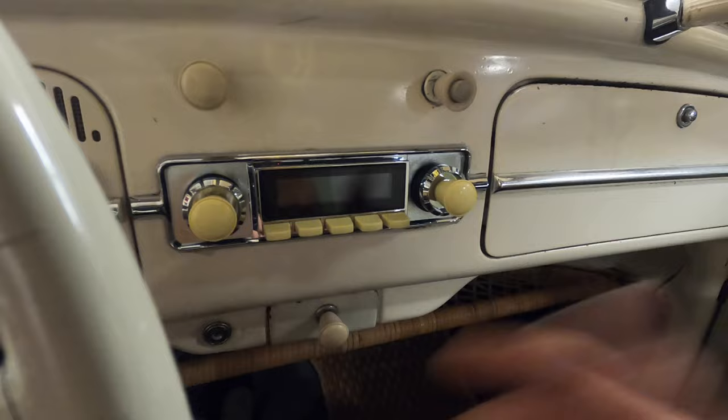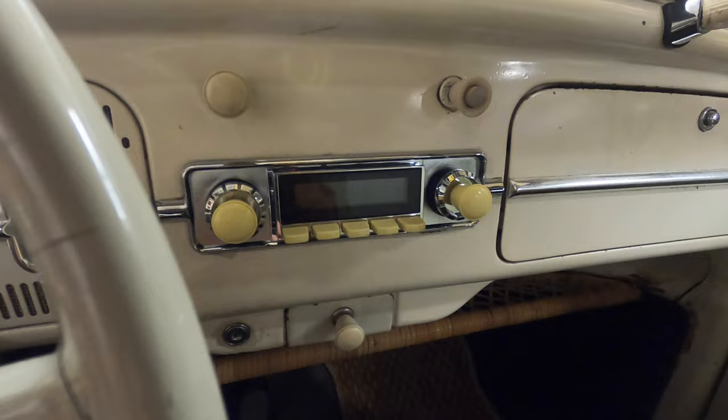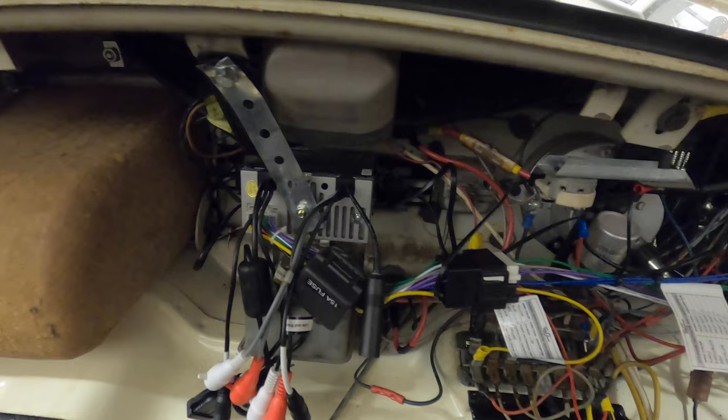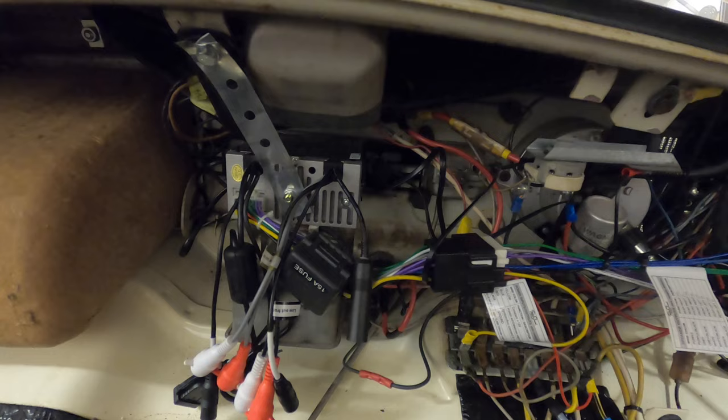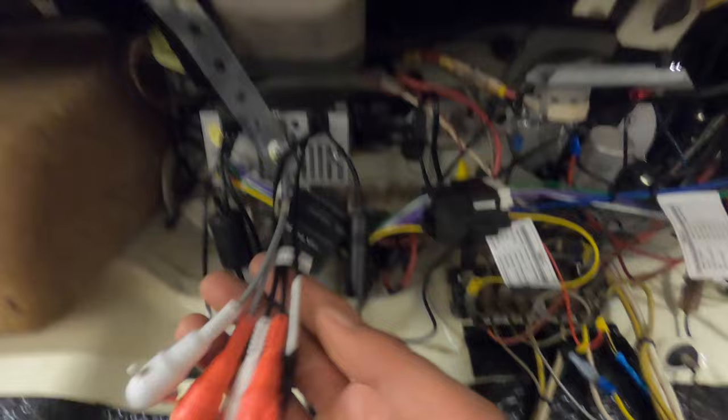This is how I'm going to have it - I've got the spacer back there and I think it looks really good. Now I'll show you the back end. There's a strap that mine did not come with, but the instructions say it should. I bought one from AutoZone. This strap is holding the back end - if you don't have it, it's going to end up cracking your front plate because it wasn't designed to hold all the weight, but it'll keep it exactly where you need it.